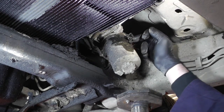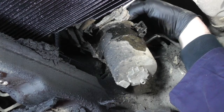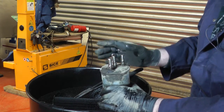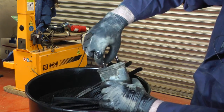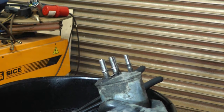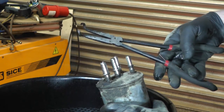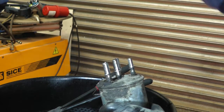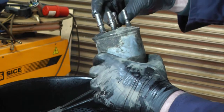Here's the fuel filter — there's a little M6 but it's an 8mm spanner-sized bolt to clamp the filter, and then there are four pipes at the top. It is a push-fit pipe with two little lugs to push in and then pull the pipes off. These fuel filters on these Discoverys are not the easiest things to get off — the location and access is very tight. There are two little plastic lugs either side that you have to push in and then pull off. I've got a pair of special pliers; you just squeeze in the two little plastic lugs and pull the pipe off. Even with them it's a difficult job — tight and the access is fairly poor — but refitting is a lot easier because you just push the pipes down and they automatically clip over the lugs and once they're on, they're on.